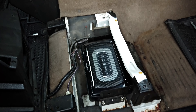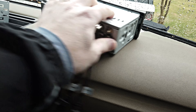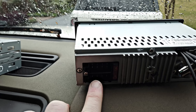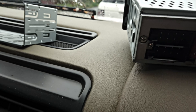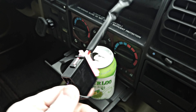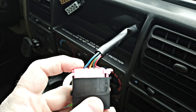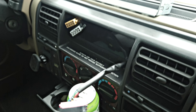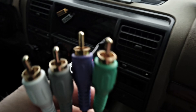In my case, I actually got pretty lucky on this radio install. This Bremen unit has two inputs in the back and a bunch of speaker inputs on the side. These two actually fit in these spots here, and I got an adapter on Amazon from Metra. These are vehicle-specific, but it basically takes the third plug that was plugged into the stock radio and converts it to RCA inputs for the four speakers — well, six speakers in this case, because there are tweeters in this car.